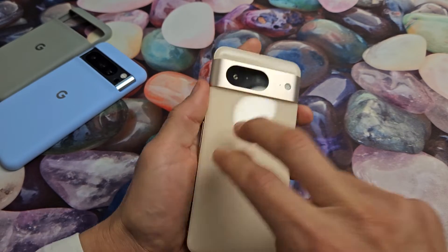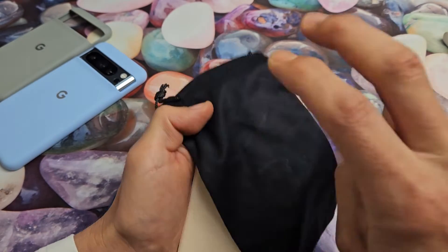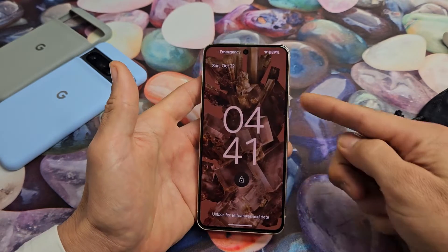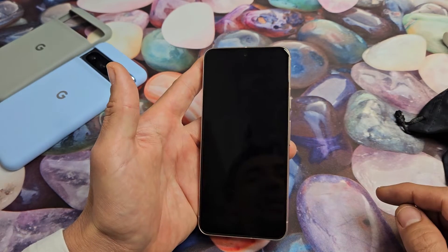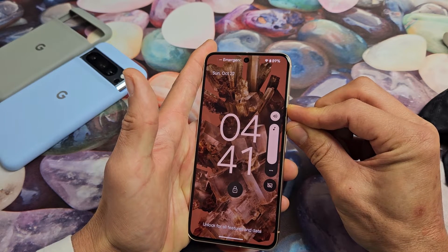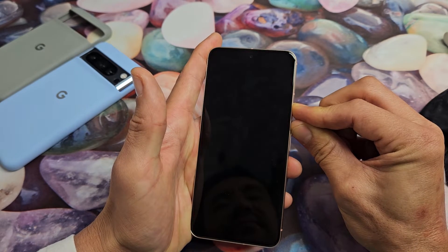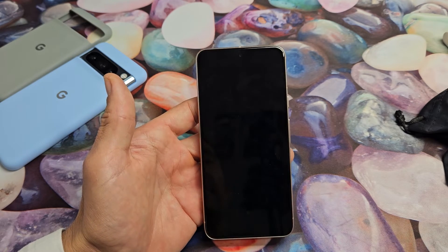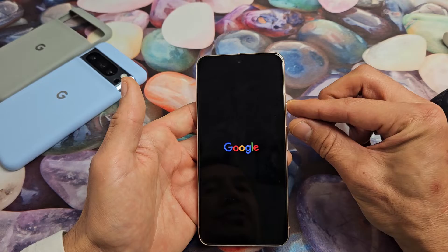Let me flip it over and do the same thing on the back — tap everywhere, even all on the camera lens. You can put something on there, but you kind of want to do it kind of hard too. All in the corners — just tap. Do that for a little bit. Then turn your phone over and hit that power button and see if your screen is on. If it's still off, no problem. From here, power button and volume up — press and hold both buttons, count to 20 seconds, let go, and wait for it to boot back up. We should see a Google logo. If you don't see a Google logo after about 30 seconds, just do the same thing over again.